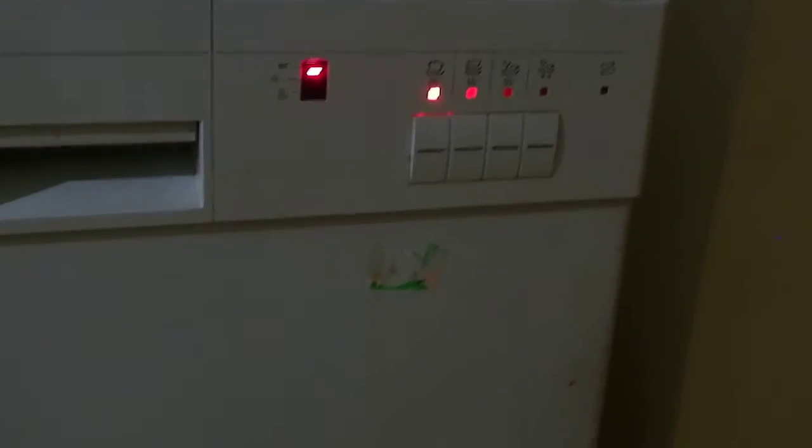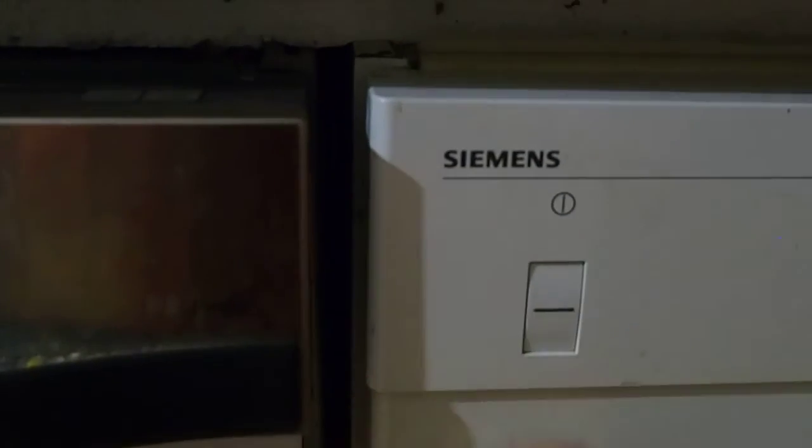This one has a complicated heat exchanger inside, and what it does is, so now it's pre-wash, and when it's in main wash, it takes the heat off the main wash. In the first rinse cycle, it takes the water from a plastic container that took the heat from the main wash, then puts it into the first rinse, a nice hot water to rinse all the dirt and detergent from the dishes. And it's eco-efficient, so the first rinse doesn't need to heat up. Of course other models don't have this, so that's why this one clogs up with mud.